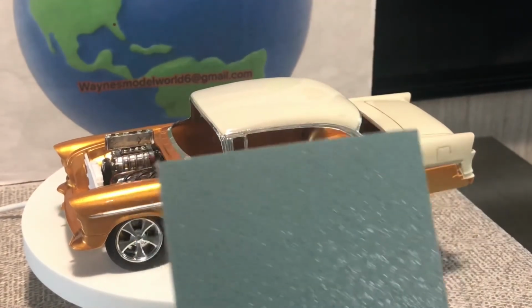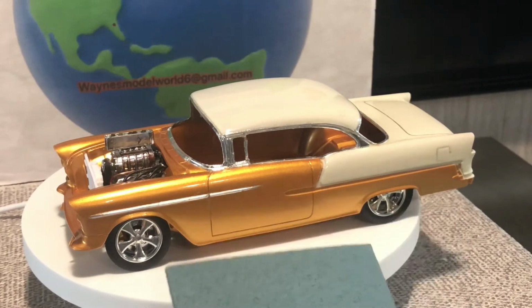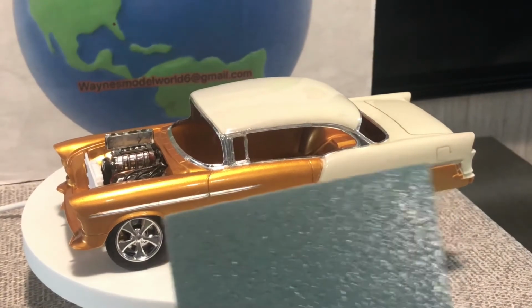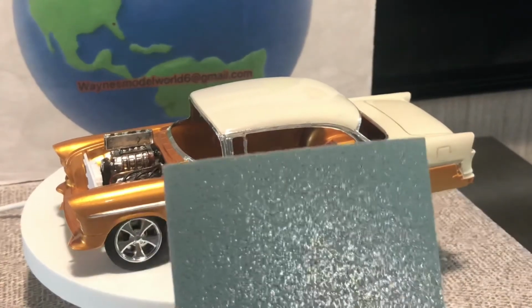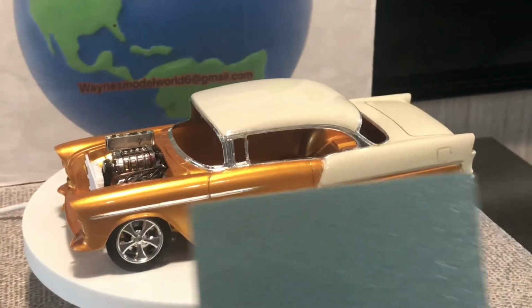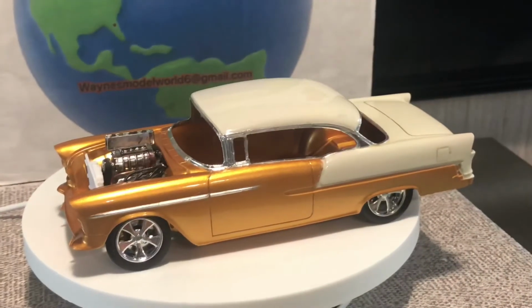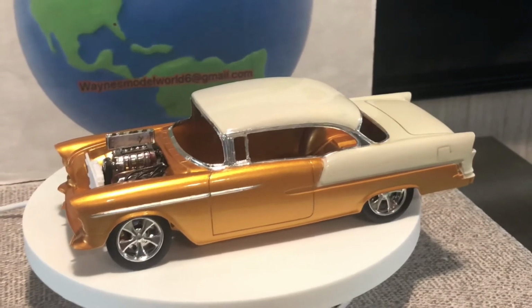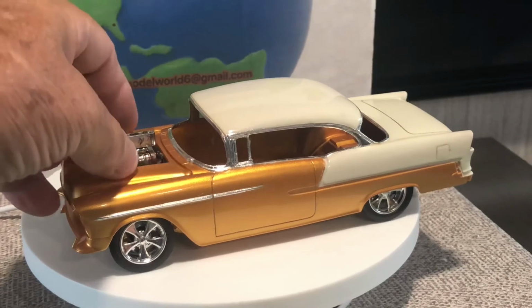For a long time, I wouldn't even sand. I'd clear my jobs and rub them from there. I wouldn't even think about sanding them because every time I sanded them, I ate up an edge and I had to repaint. And then I was in the auto parts store and I said, God, we used to use that in the body shop business. Of course, we had them come on a round pad. You put it on a DA and you wet it and you sand your clear down and you run your buffer over it and you were done. But then I said, I want to try that.